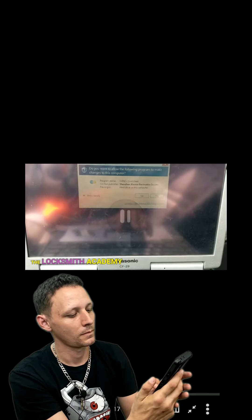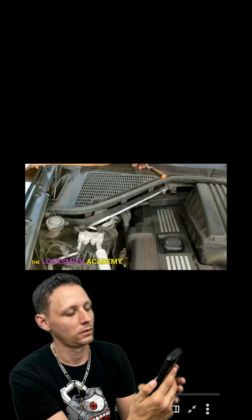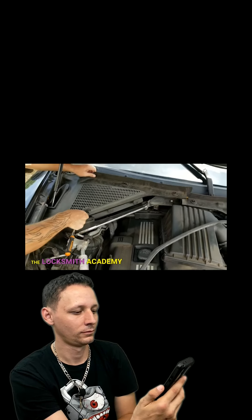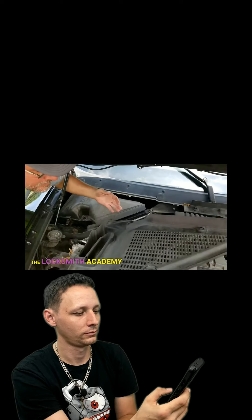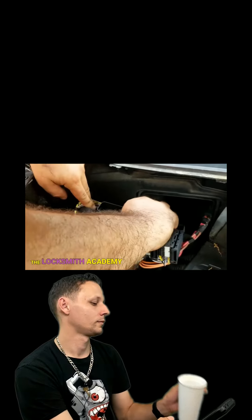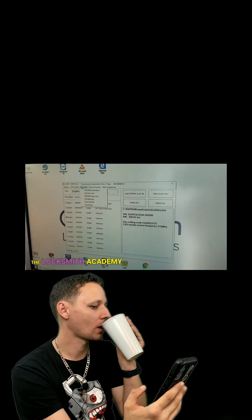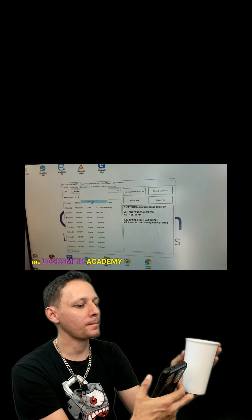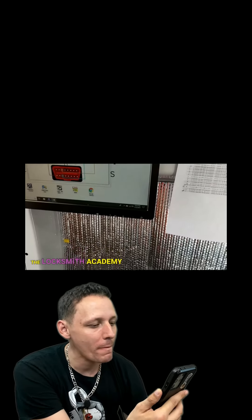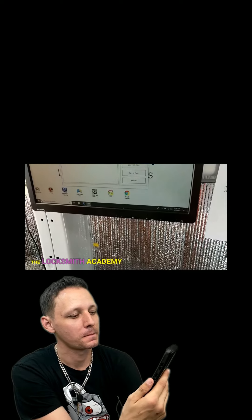First trying to connect. A key cutting code. Under T-Learn: ECU, CAS, ISN. We're going to go there. You need the cable and we're going to do our diagram - you've got to match it up to the right EEPROM DME. This is as far as I got on one. MSV80. Got it - MSV80. And here again is our connection diagram.